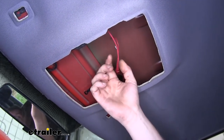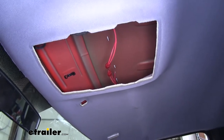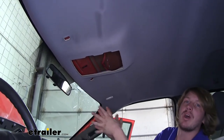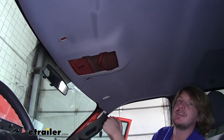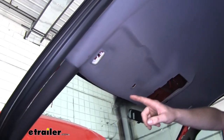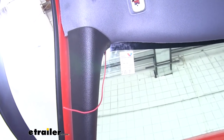You'll then take the red wires that we pushed through the roof and connect all those together using the quick splices that come in your kit. It may be necessary to use additional wire depending on the spacing between your lights. The kit comes with a switch that you could mount somewhere on your dash, but we're going to route our wiring over into our parking lights so that whenever we turn our parking lights on, our lights will come on up there. We're going to run all the way across our driver's side and connect the wire there, then route that out to our engine compartment to make our connection.